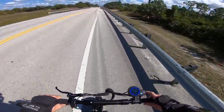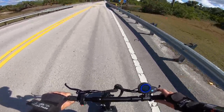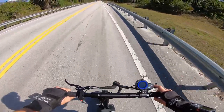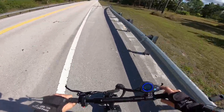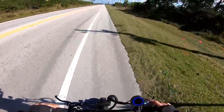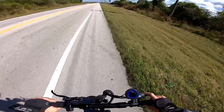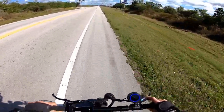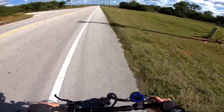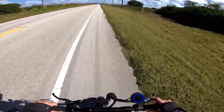I do like this fat tire — I like the way it feels on the road a little bit more than the Dualtron Thunder feels. I don't like that mystery sound from the back wheel though. It could just be the disc brake making some contact — that's my first guess. Also, I probably need to check the air pressure in the tires. I've been feeling they might be pumped a little high — maybe to max PSI. Might let a few out.